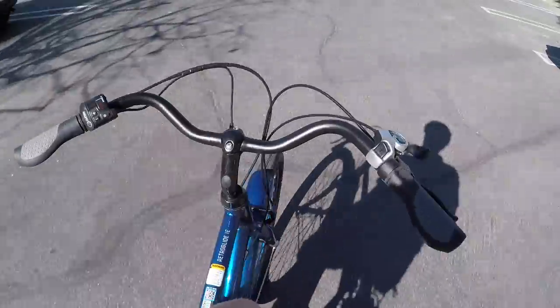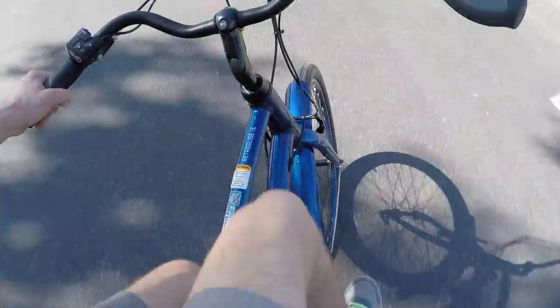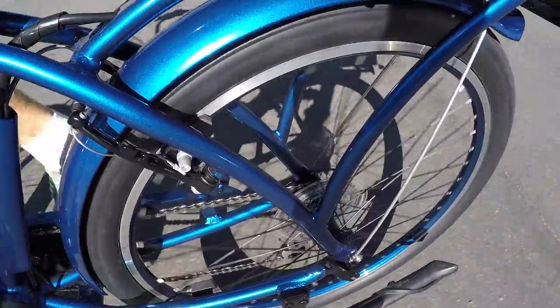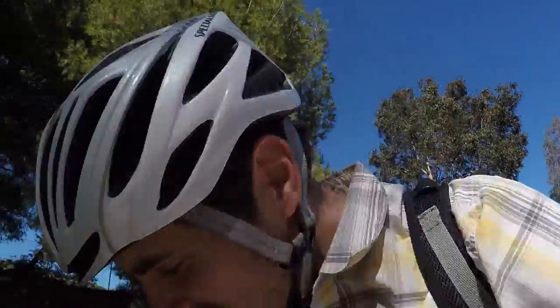There's a little bit more weight at the front but it rides kind of fine on its own. Now I'm going to go all the way up to power level four and shift gears. Oh boy — a little bit of a loud noise happening there! My drivetrain is still intact. But that's what I mean — I wasn't standing up, wasn't overdoing it with power. But that motor at its highest level of assist is really putting some energy into the chain and sprockets. So this is feedback on how to ride and work with this bike.